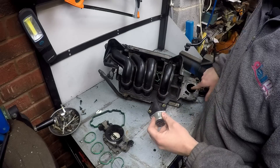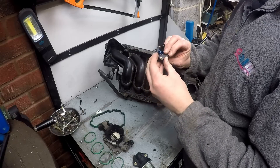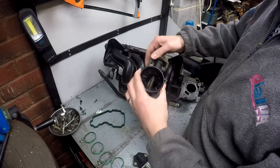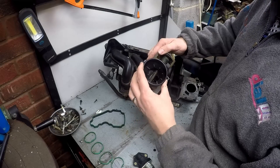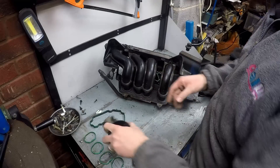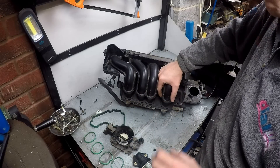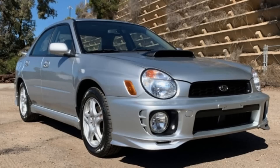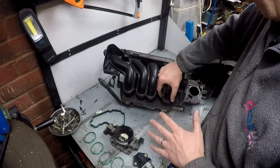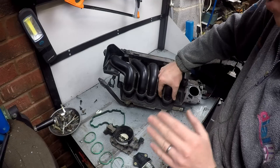Once we've stripped it down we can see there's a few sensors. We've got the idle control valve that we'll have to reuse. We've got a combined intake air temperature sensor and manifold air pressure sensor, and of course the tiny, cute, my-first throttle body — which we are not going to use, though the throttle position sensor attached to it we've got to incorporate into our new design. What I'm not seeing is a mass airflow sensor, and I was very much expecting one. Pretty much every OEM-spec car has got one, and that was going to be a really useful thing for this video, but we may have to find a way around it.